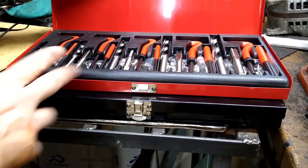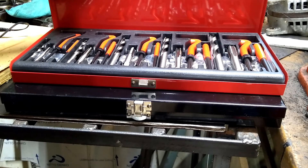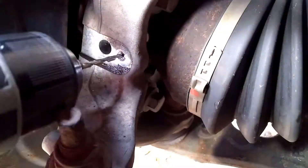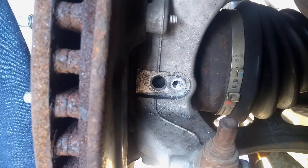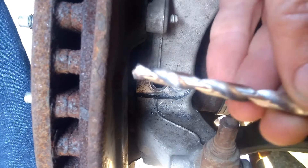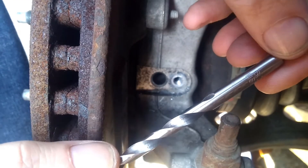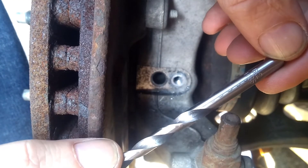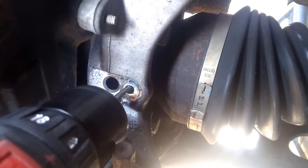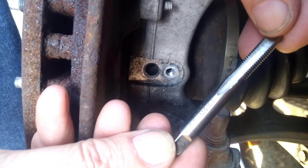Let's take a look at how I use this for fixing that Ford Flex, starting with drilling out the existing bolt. Now that we've got it drilled out and the broken bolt removed, we're going to use the drill bit that comes with the helical thread insert kit. This one looks like a 6.2. Then we'll tap it with the tap that came with the kit as well.